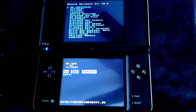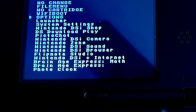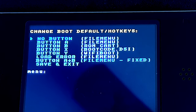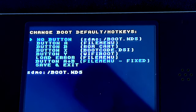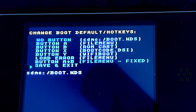You can access the Unlaunch File menu anytime by powering on your DSi while holding both A and B simultaneously. In the top display, use the D-pad to move the highlight arrow down to Options and select it with A. This lets you change your default boot settings from the old DSi menu to the new Twilight Menu. Make sure the highlight is on No Button and select it with A. Use the D-pad to move the highlight down until you see the first listing for Twilight Menu++ and select it — you'll now be booting to SD memory card slash boot.nds. Use the D-pad to move down to Save and Exit and select it with A to lock in your changes.